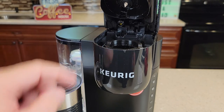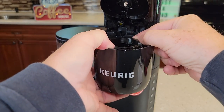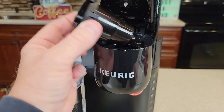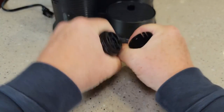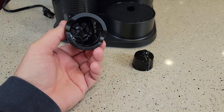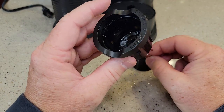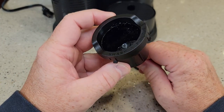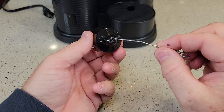We're going to take this lower needle basket out. We can remove the lower needle and clean it. What I like to do is poke up from the bottom — there's nothing sharp on the bottom, the sharp needle is down in there. Just poke from the bottom and this whole lower needle basket area will come out. Here we have the needle basket area. This comes apart — just put it in your hand and tear it apart like that. There are two little notches that go into these little grooves here. Now this lower needle, we can still see it there. We're going to use the paper clip from the bottom. Take this over to your sink and run the paper clip up through there and turn it. As you're running it through there, that should clean up all of the coffee grounds that are in that needle. You'll be surprised — this lower piece here can also get clogged.